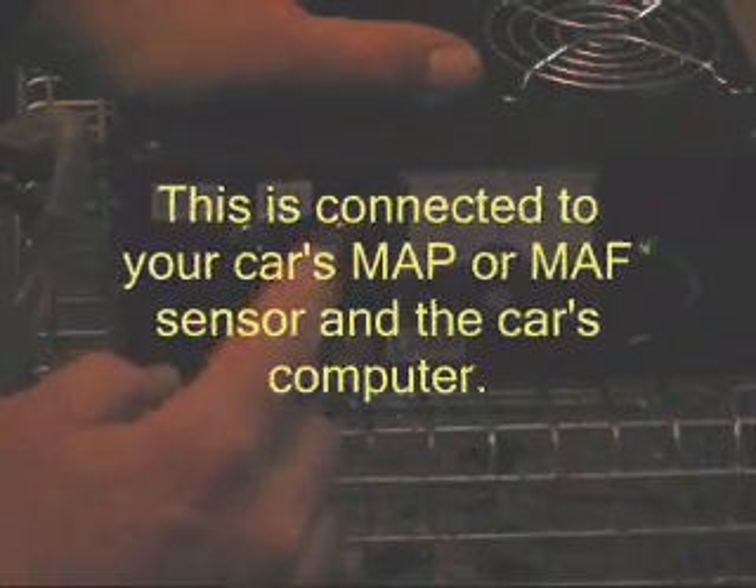About the dual edge MAP sensor enhancer: this is your on/off switch, and when it's on the dials are enabled. This switch decides which knob is active. You set one side for city driving and one side for highway driving. As you turn this dial up, it leans out your fuel-air mixture. You'll have a different engine RPM for city driving than for highway. Once you set them, you don't need to mess with them while driving — just turn the unit on, decide city or highway, operate the switch to that dial, and go down the road. I want this to be as simple as possible.